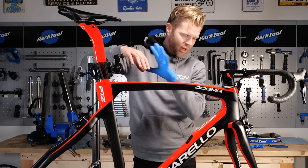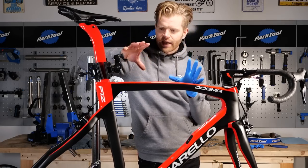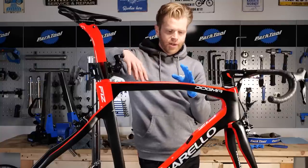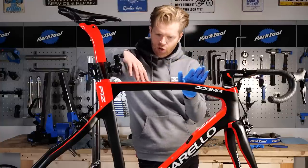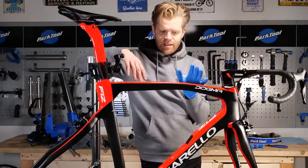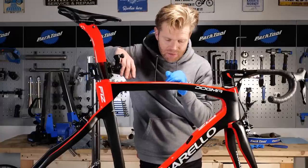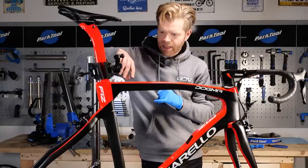And once your ceramic coat is on and it's cured, I find it's really effective because what it allows you to do is more effective non-contact washing. Contact washing is where you get a sponge or a wash mitt and you're physically touching the surface. If you do this, it's going to cause little swirls and marks in your paint. I can actually see Alex has done this. The light is showing up little cuts in the lacquer and swirls in the paint there.